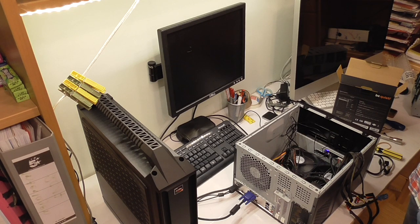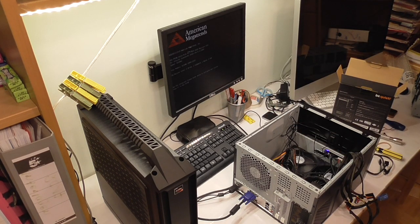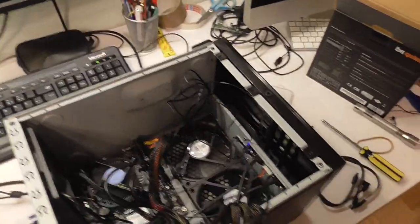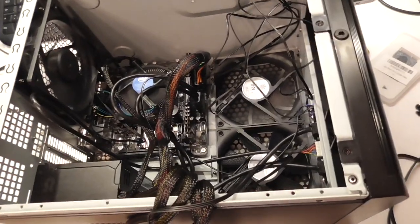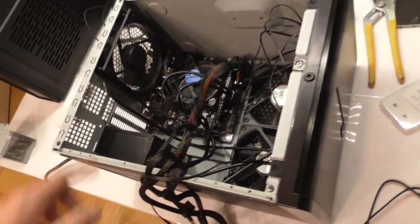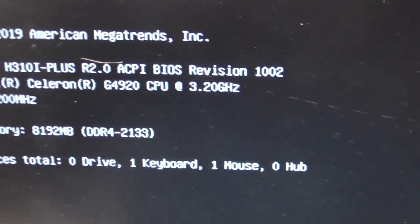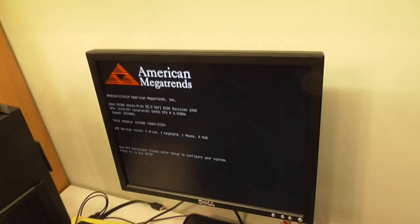Let's see if it does something. I don't know what people mean about Intel CPU fans being noisy. Any posts? Yes! Woo — ASUS In Search of Incredible. Success! It's always rewarding when it boots after you've ripped your hair out with all the cables. So, the CPU fan hesitated but it does spin now. We have the G4920 Celeron at 3.2 GHz, 8 gigabytes of RAM — everything fine. However, bad news: for some reason it won't boot Windows 10 from the MacBook's hard drive. I think it just doesn't want to boot on a PC after being in a MacBook.